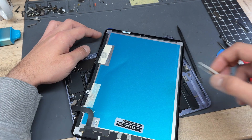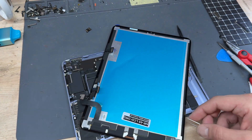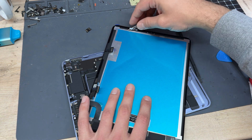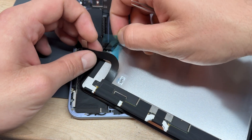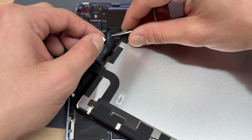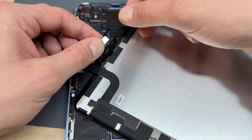I'll try to put a link in the description below. I'm going to remove all the tape on the back of the display — there is also a film on the backlight here, which we'll get out of the way. These are always horrible to remove. There is another bit on the back of the LCD and the same on the back of this touch flex. Just be careful when handling these because whilst that bit looks wide, they've attached to two very thin cables.